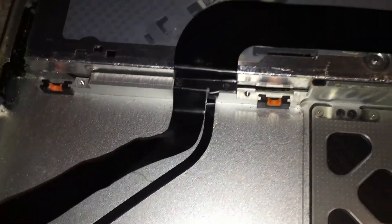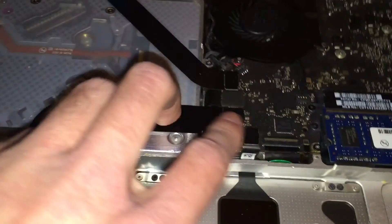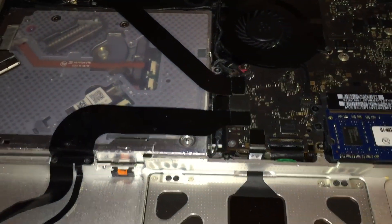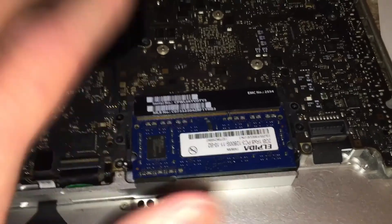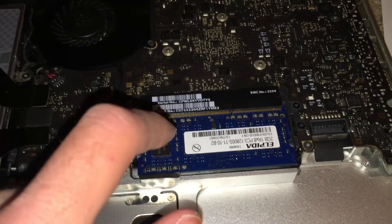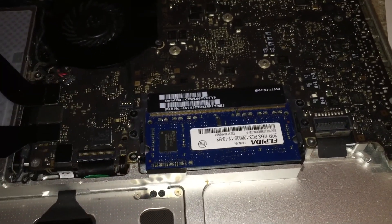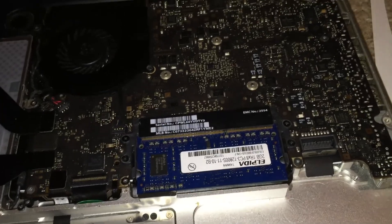This hard drive cable is probably destroyed — it looks all kinked up and ruined. I did test it; the little LED on the front doesn't even come on when it's plugged in, so that's probably bad. The last thing that's messed up is the lower RAM slot does not work whatsoever — if there's a module in that slot, the system just beeps three times and won't boot.